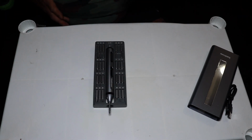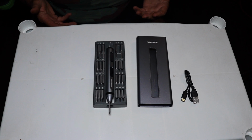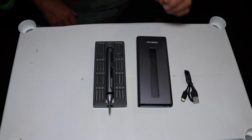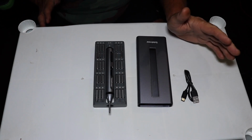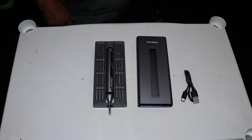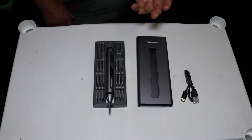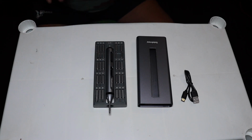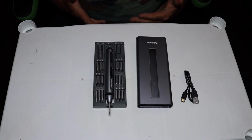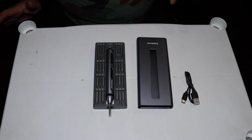You don't want to overdo it, and that is the one thing I can appreciate about the two kits I've gotten so far, is neither one of them has enough torque to strip the screws or break anything free. And that's a big thing when you're working on computers. A lot of the screws that hold down your motherboard and whatnot, or some other parts maybe, those little threaded rings, we'll call them that, or mounts, they're only soldered in place. And if you go too crazy with torque on them, yeah, they can break free from the board, and then you've got to solder it back on, and that can be a real nightmare proposition, because you are talking more into the microelectronics, and hey, it's not exactly a fun task. So this is why you don't over tighten stuff. You just need enough that it's snug. It's not going to go anywhere.